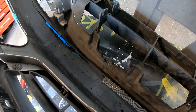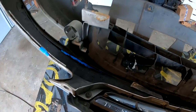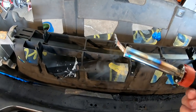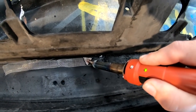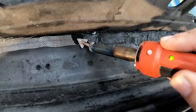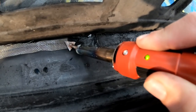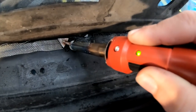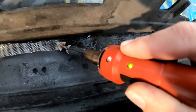The tape is holding it together and I've already got my metal mesh in place — I tacked down the edge so I can hold the camera and have a free hand. The metal mesh is there and I haven't added any material yet. I just use this tool that came with the plastic welding kit — basically a hot stick. What you do is push the plastic down, hold it for about 10 seconds, and you can see the plastic starting to heat up. Once the metal gets hot, it kind of melts into the plastic a little easier. Starting off is slower, and this is time consuming just like everything else when working on a car. You've got to take your time and work it in — it doesn't have to look super fancy, it just has to be good enough for strength.